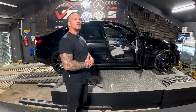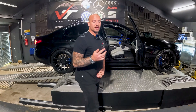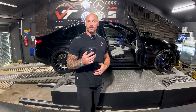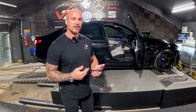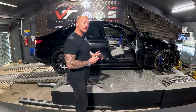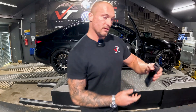As you can see, the car is beginning to flash again. This car has two ECUs, and I failed it purposely on the first ECU — so I'm now actually on to the second one, and I'm just coming to the end of that flash. This is the fast flash option. Because the car already has this on it, I can flash it really fast as it's just a partial flash. You're likely going to find that the first time you flash a car like this it's going to take 10–15 minutes — hence why having battery support is so important. We've now got success.